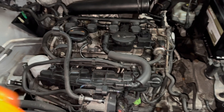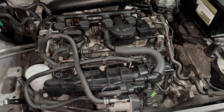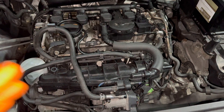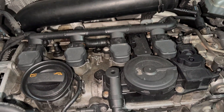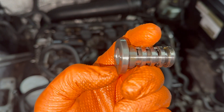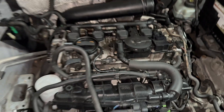If you're dealing with a no-start or you're getting cam codes — the P0341 and all those codes that have to do with timing — and if the car is not starting, I have a lot of videos on the oil control valve, which is right here. I show you what a good one looks like and what a bad one looks like; that bad one will give you those codes.